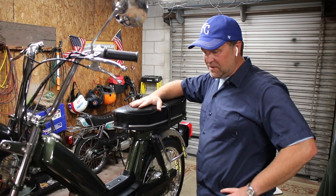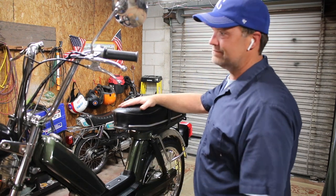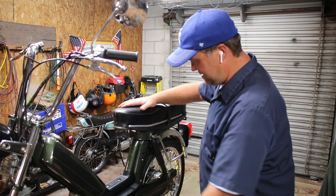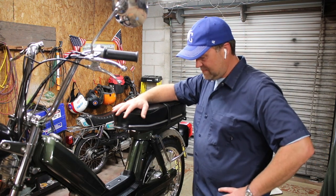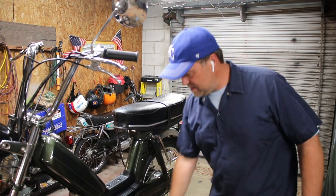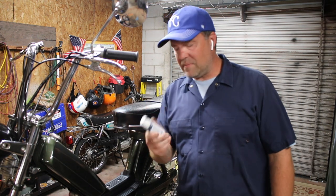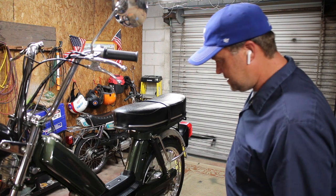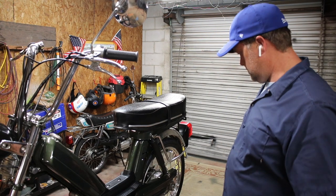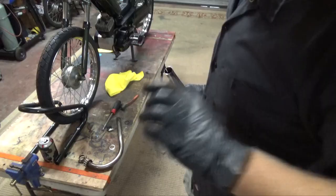I think all I have left to do is to hook up the brakes. Is that really all I got? The brakes and the exhaust? Yeah. Holy crap, that thing came together. Oh, I've got a bunch of nuts to tighten. I've been leaving stuff a little loose, and then I'm gonna come back and put some Loctite on it just to make sure it's in there good. These, everything on the front forks, a couple other things. I'm gonna go do that right now.